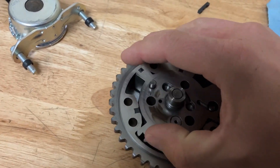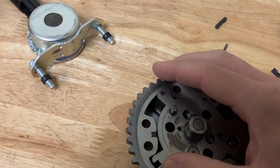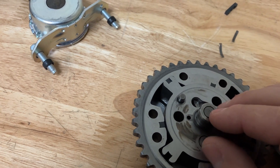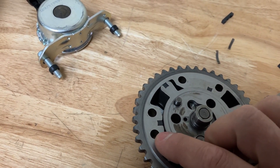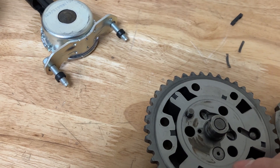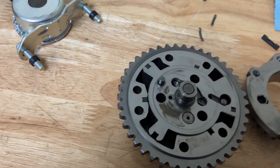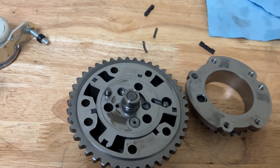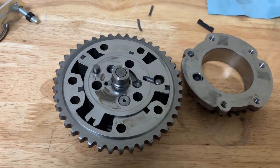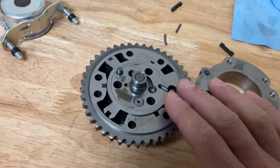Here's the chamber. If the chamber is full of oil and nice oil pressure — not low oil pressure — then it's full, fully advanced or fully retarded depending on intake versus exhaust. So this would be exhaust fully retarded. The ECU will bleed off pressure to move the camshaft to the desired position — it bleeds from this chamber, and that's how it works. There's another chamber on the other side, same thing, so it can move it either way as necessary. The valve springs push on the lash adjusters and rocker followers. With good oil pressure, lash adjusters are fully pumped up, rocker followers push on the lobes of the camshaft — they have ball bearings and a roller on them — so they will move that camshaft around. And this is just how we control it.